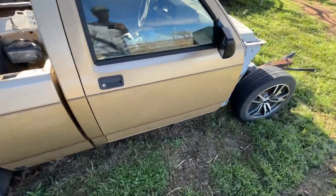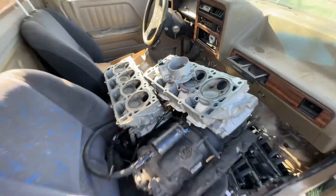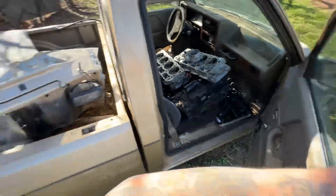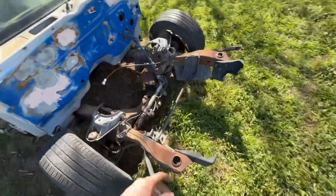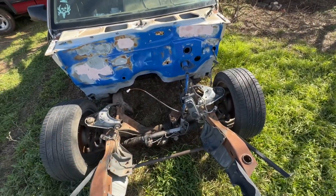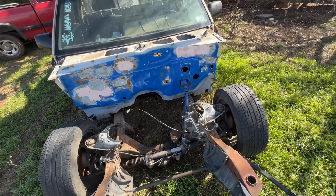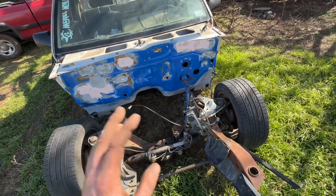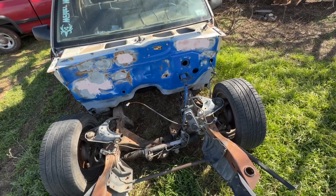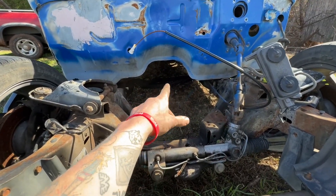This is what the Hemi's going into — and the T56. There are some Hemi heads in there. I don't know if the bell housing's still in here. I actually daily drive this one — it's fun because I can just beat on it. The front clip's off because I was cleaning up the firewall. I want it to look really nice inside the engine bay, so I got to finish sanding all this someday. I pretty much just need an oil pan and heads, and I can drop the engine in with the transmission and start mocking all that stuff up. I didn't think about whether I'm going to have to cut that out more to fit the T56.